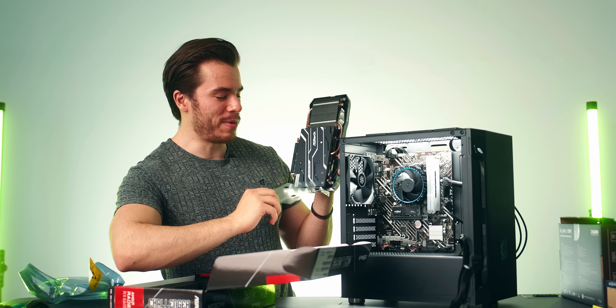Let's boot up the computer. First make sure the power cable is plugged from the back of the PSU to your wall outlet and flip the switch from O to the line. Plug in your keyboard, mouse, and a display cable — DisplayPort or HDMI — from the graphics card to the monitor. You'll also need a Windows bootable USB drive; I'm going with Windows 11 since we have Wi-Fi. Plug the USB into a USB 3.0 port on the back and press the power button.